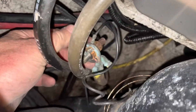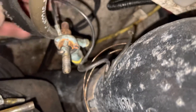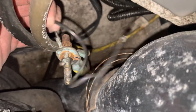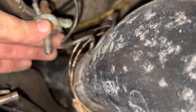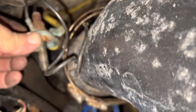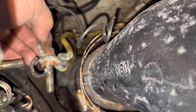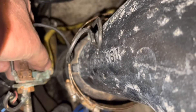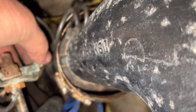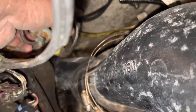The back stud did not come out cleanly — it just spun out of the block and in doing so twisted off a wire going to the transom, and also twisted the fuel injection harness wire off. I'll splice a new connector on that and solder it up. It's a mystery how it spun out without me trying to twist those yellow wires.